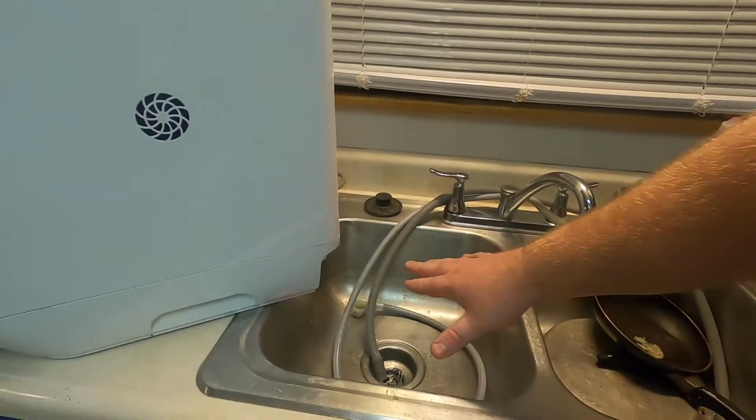First of all, I looked online, on YouTube, for what E4 means. With other dishwashers, it's generally kind of a blanket error code. What other people have suggested with the E4 overflow code is to simply turn your dishwasher onto its side and allow water to pour out. Obviously, for us on the countertop, we just pour that into the sink. I simply tilted it to the right and water poured out the side, which seems a little odd to do with your dishwasher. But if you look up E4 on YouTube, you will see tons of full-size dishwashers where that's literally what you're supposed to do.